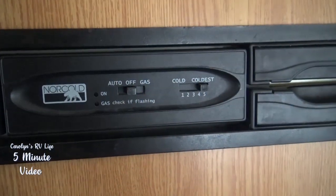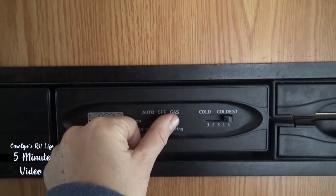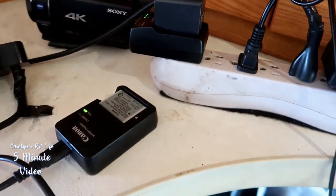In addition to my laptop, the only things I'm running on electricity are the refrigerator — it mostly runs on propane, it's a two-way refrigerator — it mostly runs on propane unless I plug it into AC or shore power. But the starter on that is electric, so you do need some battery power just to keep the starter going and keep the temperature regulated. It won't run without a little bit of battery, but that's just a small draw. The other battery draw is charging all my camera batteries — that's not really a lot, but it's another thing plugged into my inverter.